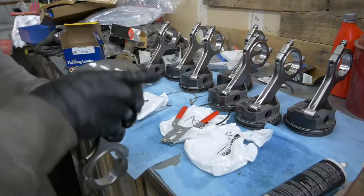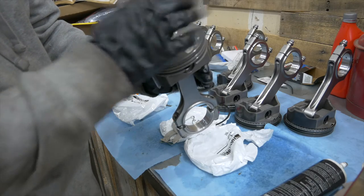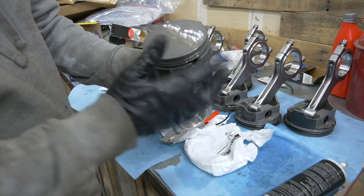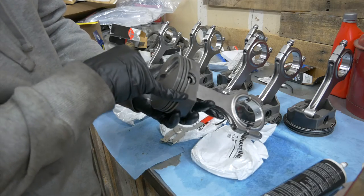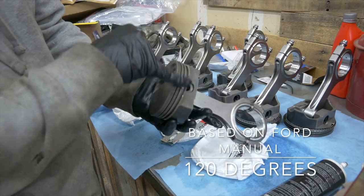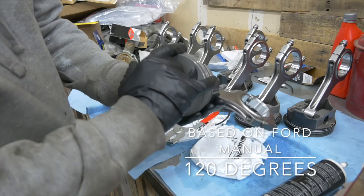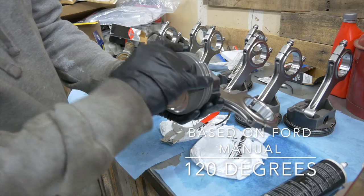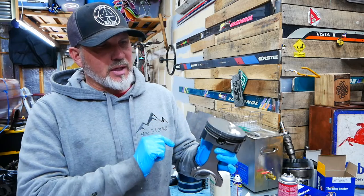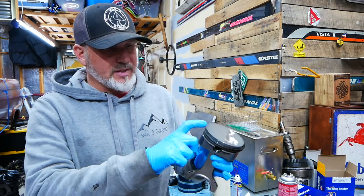Now we're on to the rings. For piston number eight in the bore: to my right is the back of the engine, to my left is the front. We're going to install the oil rings so that they're gapped toward the back of the engine — bottom ring, spacer, oil ring — about an inch apart from the center of the spacer. Then we'll put the two compression rings at either end. With stroker motors you have more compact pistons, so the distance between the top ring and the oil ring and the skirt length is much more compact than in a stock 5.0 piston.